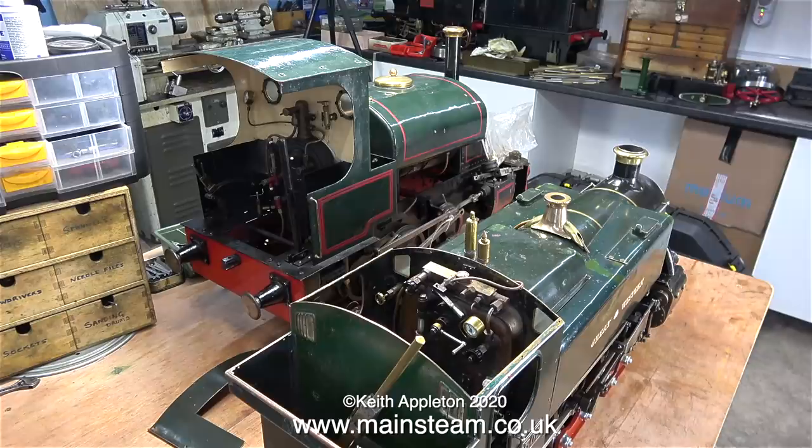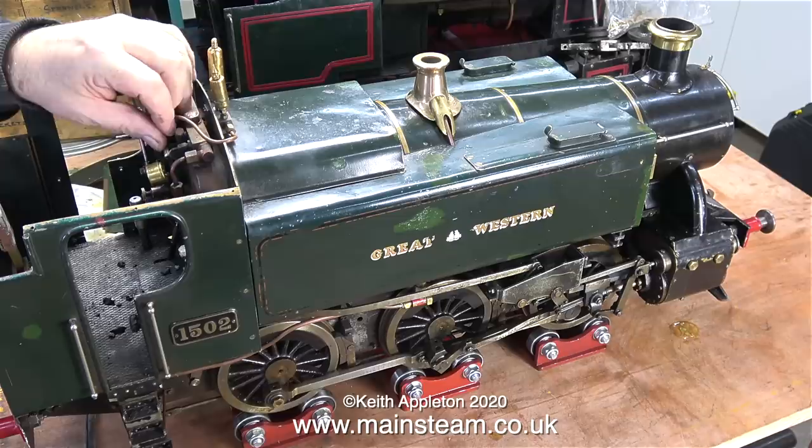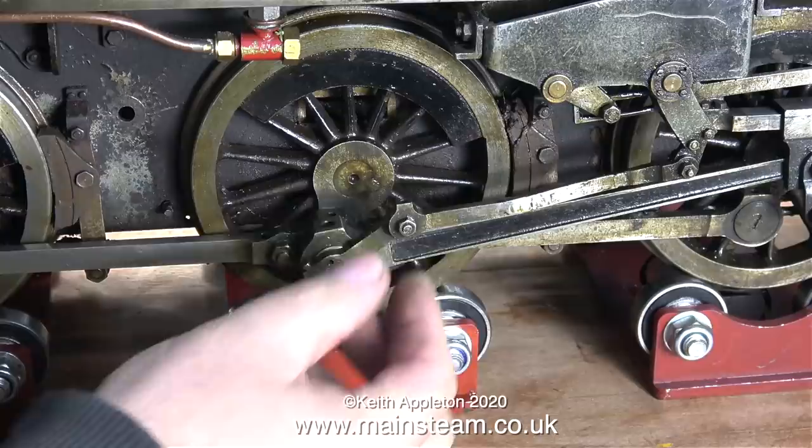I think I need to have a feel at the wheels with my hands. The first thing to do is to make sure that there isn't any pressure in the boiler. I've turned off the compressed air supply. By blowing the whistle, this tells me there's no pressure at all in there. So now I can put my hands around the wheels and rotate them slightly. And what do I feel? A big problem — as I gently turn the wheels in either direction, this is as far as they go.